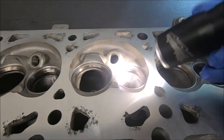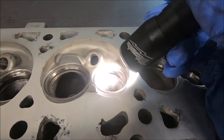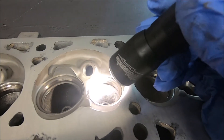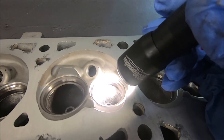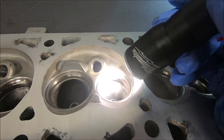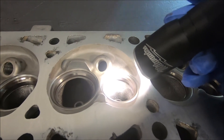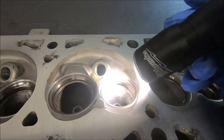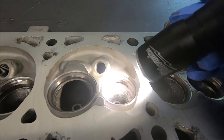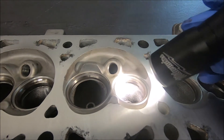What you're looking for — if you have a bigger issue and need to do a valve job, it's going to be most likely on the exhaust side because that's where most of the heat is. It'll be in the form of pitting all around on the contact area on the 45-degree angle. If you've got some major pitting on there, it's not going to come out with valve lapping. It's going to take a very, very long time, and it's only going to be on the surface it contacts. It's not good practice to try and lap out pitting — you need to actually machine it or stone it down to fix that 45.